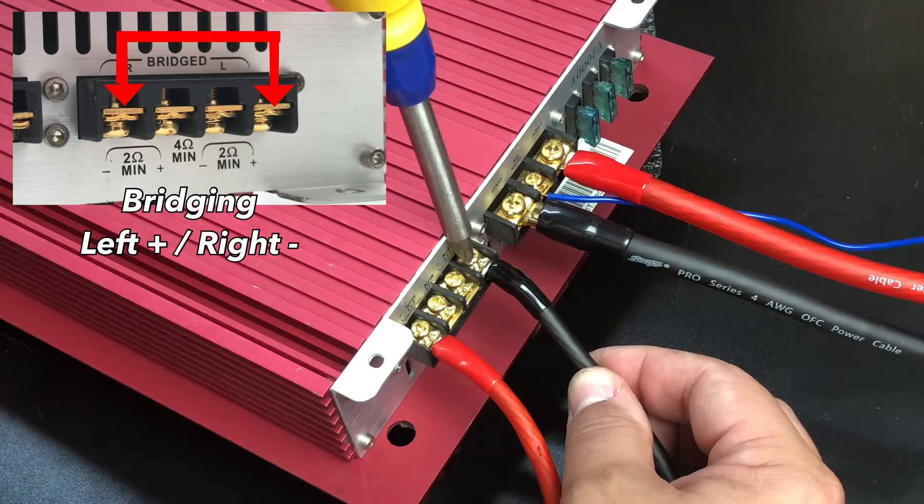Now let's take a look at the results. I didn't show all the tests but I have them listed on the dyno sheet — you can pause to see all the results. Some additional tests I didn't show include the 4-ohm mono test where it's rated 900 watts and it did 928 — it actually did really well until we got to the 2-ohm mono rating where it didn't meet its 2,000-watt claim. Big shout out to Brad over at Legends of Car Audio for sending this amp, and to all my supporters at patreon.com/oldschoolstereo. Thanks for watching — until next time, BDWiz, I'm out of here!